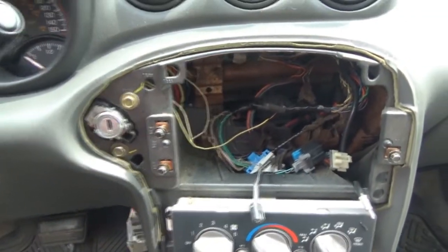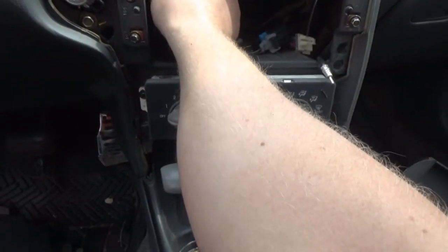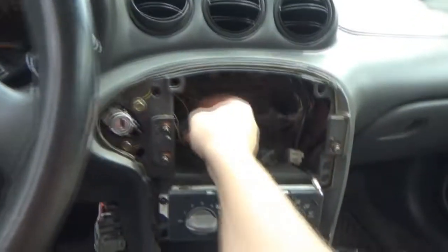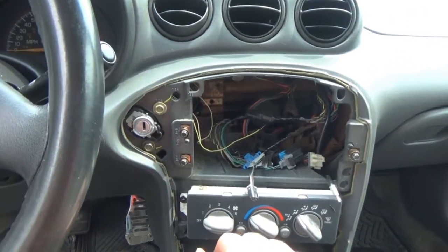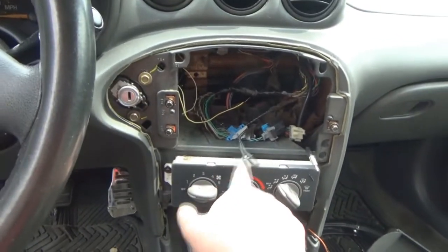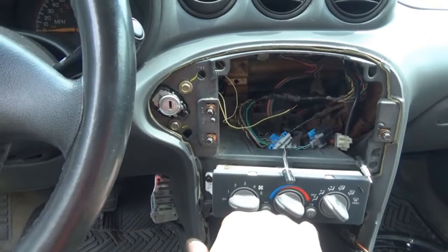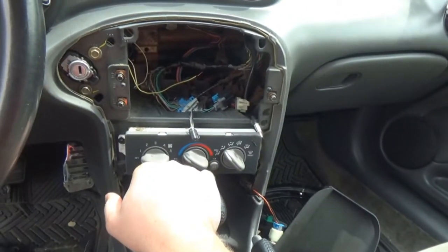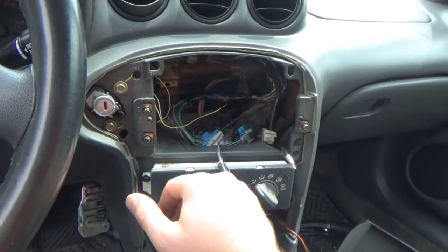Hey, so on the topic of this yellow wire, I'm going to try again to at least get these to twist just enough to make contact, because I really want to know if this thing's going to start without that system in it. This is so short back here, I'm not 100% sure I'll be able to get it to twist. I tried a little last night, but it kept getting dark, and I was getting tired and frustrated, so I gave up. But tonight, regardless of whether I can twist it or not, I'll probably see if I can bring home that crimper, and we'll crimp it together like we did this. I really hope that remote system didn't have a specific bypass for this car, because if it does, I'm going to have to figure out a way to keep just that aspect of it without putting that entire thing back in. So this is going to be interesting.